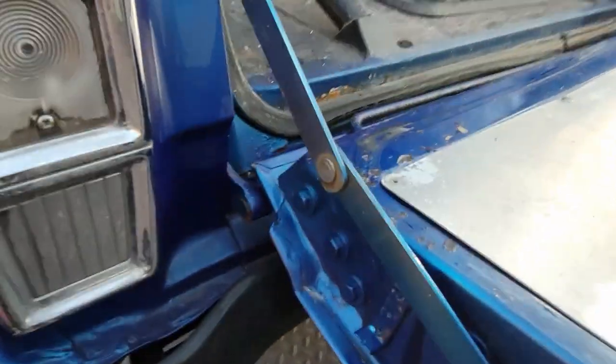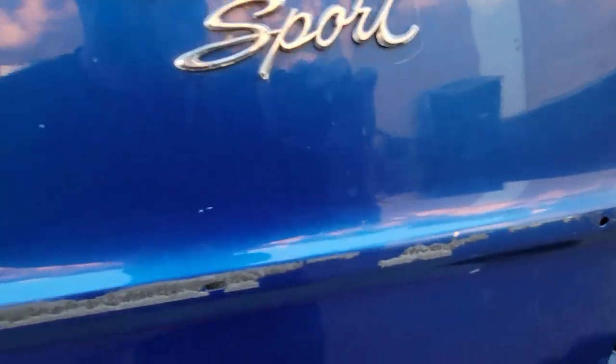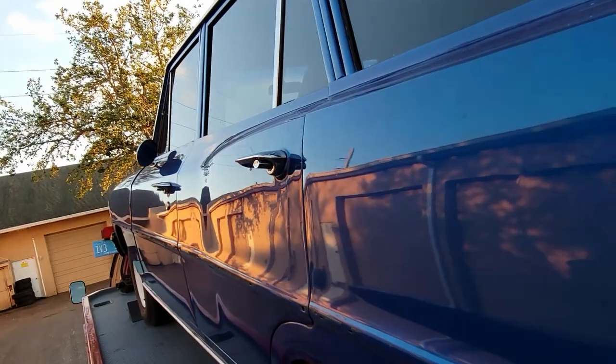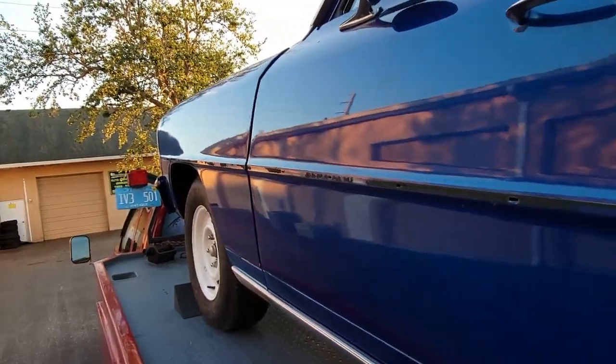And I think because they put this floor in, if you look, where the floor is, from underneath, none of this has rust. So I think when they welded in the floor, they maybe got some warpage. I don't know. Skim coated it, and then it's blistering from age because they didn't do a real good job with the paint. The body's real straight, but it's almost like they didn't let it sit long enough or something. So I'm thinking this whole car was skim coated. I mean, a long time ago. That's why it's pretty straight.